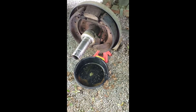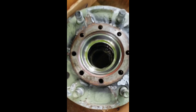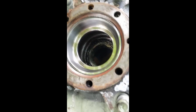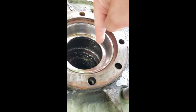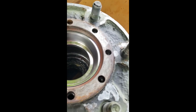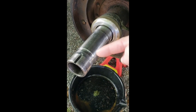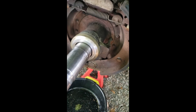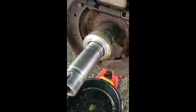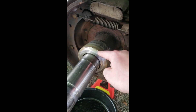That's how it works on this truck. It actually takes quite a few seals to keep air in the hub. For example, so the air is not coming out of this hub here — there's actually an inner seal, it's part of what's called the quad seal, right here inside this seal retainer. On the outer bearing, there's actually an additional O-ring that butts up against this part of the spindle right here. And there's another O-ring that sits in a groove in the inner bearing that butts up against the sleeve.